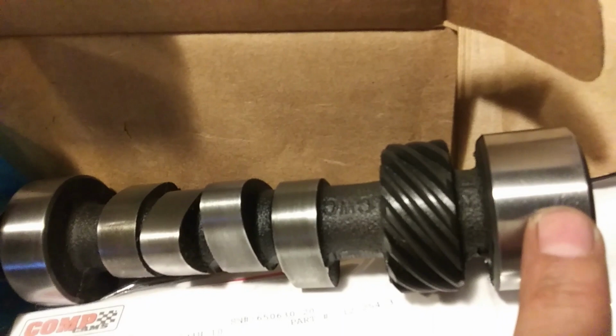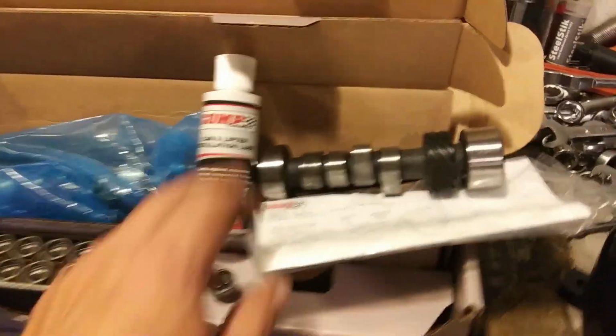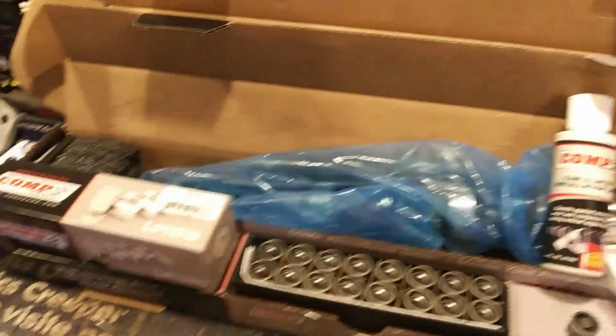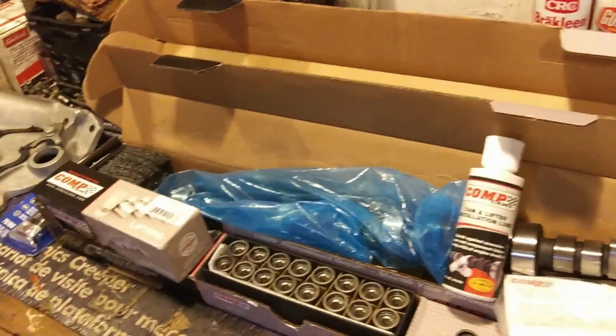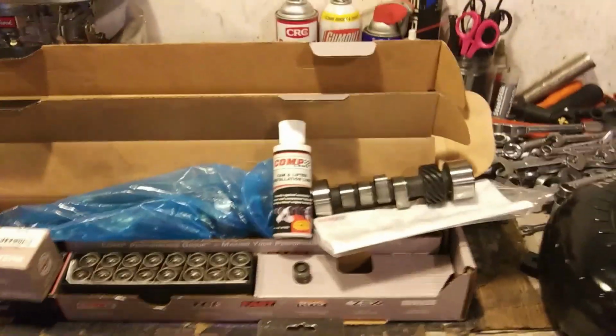But yeah, I don't have a factory emery cloth with 2,000, 2,500, 5,000 emery cloth, whatever they're using. Yeah, I just wanted to use a rough emery cloth to knock that down, and that's exactly what I did on every single one of them, including the cam eccentric on the very end right there. I didn't want that cam rod to have to knock all of that black stuff off of that cam and put all of that contamination into my oil right off the get-go.